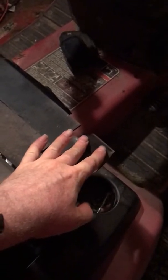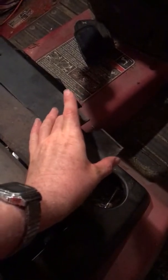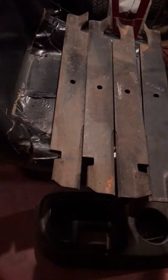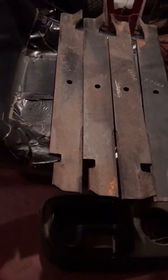It's kind of similar to the Oregon blades. I've got Oregon blades on this 522xi. The Oregon blades have a nice wing on the end, except it's a little bit longer than that. They tend to pull the grass up, give a little bit better vacuum, and cut the blade and kick it out. That's the way I like it. I don't like mulching blades - they don't have as good of a vacuum effect.